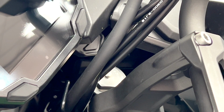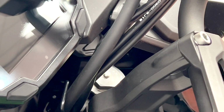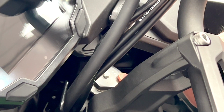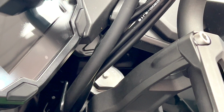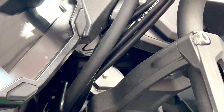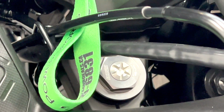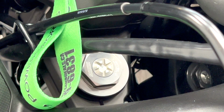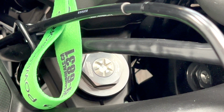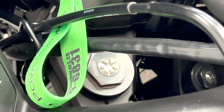So we talked about the adjustable suspension there. Kawasaki labels these a little different. They are Showa shocks, so tension, hard and soft, H and S, and then this one is preload, H and L, high and low for preload. So that's your tension over there, compression rebound. And then over on this shock, a little different adjustment there, and you can see Showa shocks there for your preload as well. So preload and compression rebound damping, all available on the front fork, which again, really stands out in this 650 class, even within the 650 class of bikes within Kawasaki.